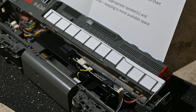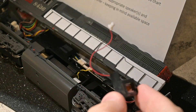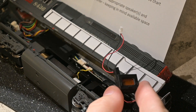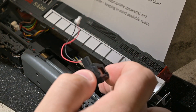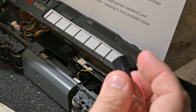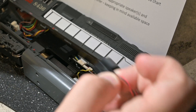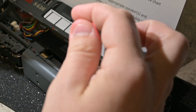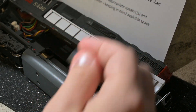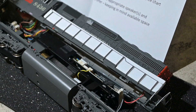The speaker install is going to be a little more involved than I first thought. The speaker is essentially going to have to go in with tabs beneath the weight and the chassis where everything's got to sit down flush. I'm going to pull the weight up — that just requires unscrewing two screws, popping it up and snapping it into place. A little more involved than I thought, but we're going to see how this speaker sounds. There are two Phillips head screws right here — you're going to have to get in there at an angle and just pop them up.